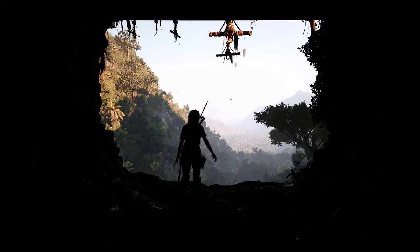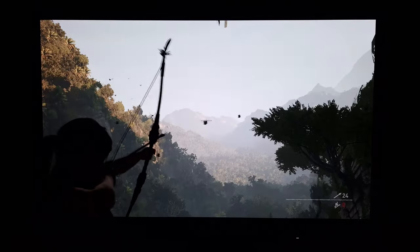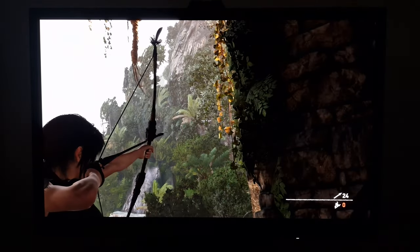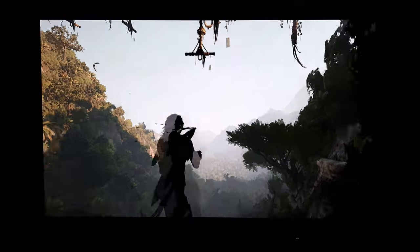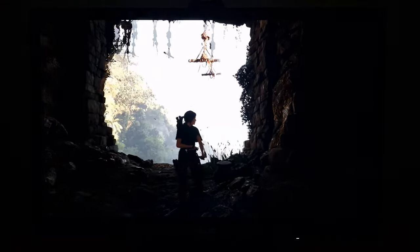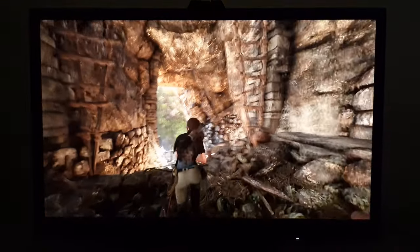But this is really between a 49% white patch and 100% white patch at the moment, especially when I zoom in here. So there is a bit of dimming, but it's not obvious. I've actually measured this for similar scenes in-game, and it tends to stick above 400 nits still. So yeah, it's pretty bright, but again, this isn't super bright by HDR standards, but it is pretty consistent, so there aren't obvious shifts as lots of bright shades are introduced.